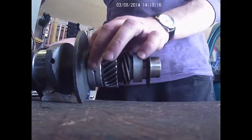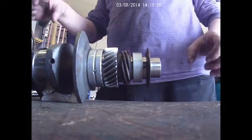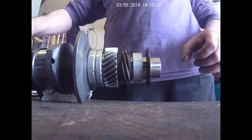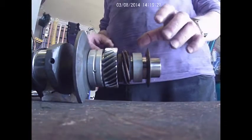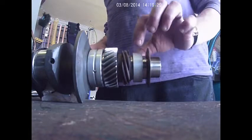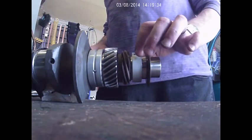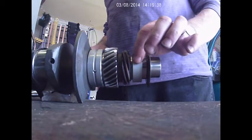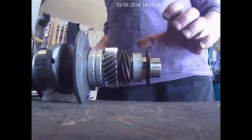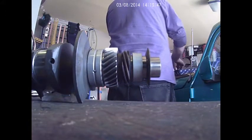I already went ahead and grooved all the bearings. The saddle for the mains, they've been grooved. And the main bearing for the flywheel is all done. You don't do the groove on this one. No, you don't do that. This is only for the load of the alternator belt, so you don't do any modifications on this little tiny bearing. Time to put the rods on, which we've got right here.